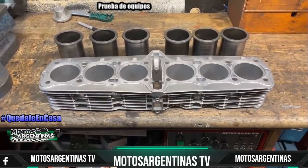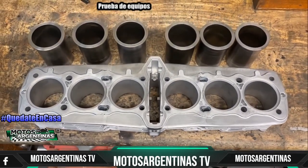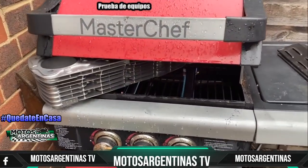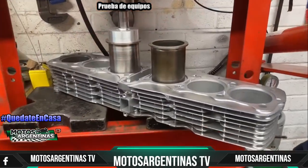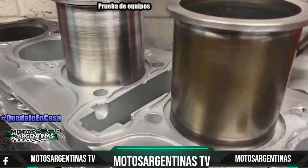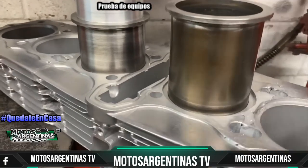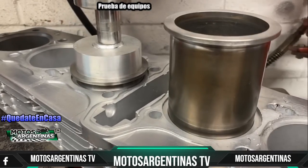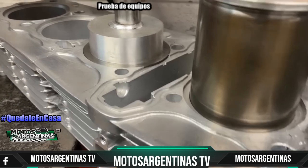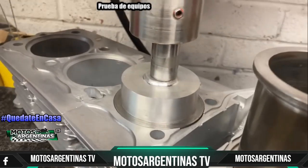With all the fin welds polished and the top and bottom surfaces flat, it's time to replace the liners into their original holes in the bore. So to do that, I first put the barrel in my barbecue to warm it up. With the barrels nice and warm, I return it to my hydraulic press and start pressing in the liners. They take no effort and slide straight in. I check with my thumb that it's flush, which it is, then I proceed to the next liner.